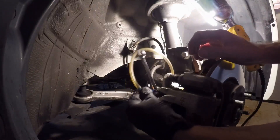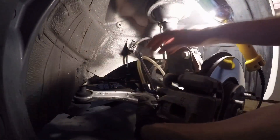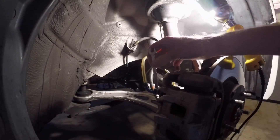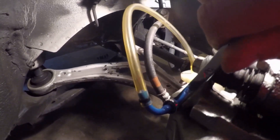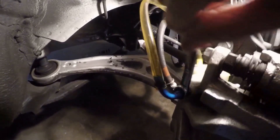Just waiting for my partner to get these brakes done — should be five to ten minutes at most. Once done I can get everything bolted back together and have assurance there's no air in the brakes. Okay — pump it and hold it, three pumps and hold it. Tell me when you're holding it. Keep holding until I tell you we're done. Okay, do it one more time — see those bubbles?